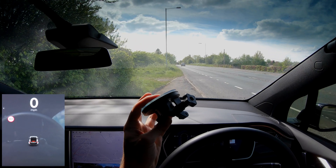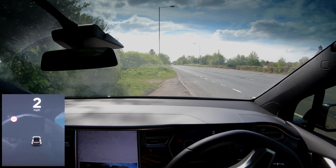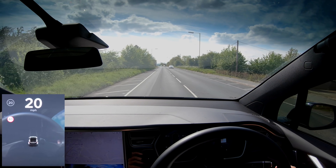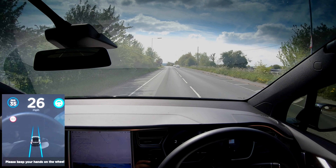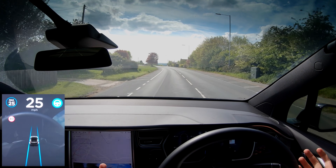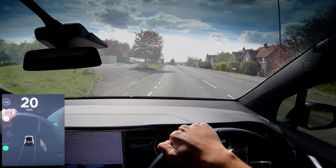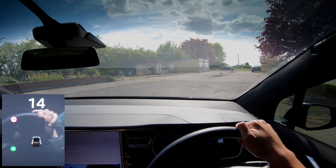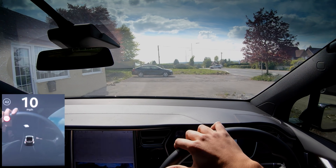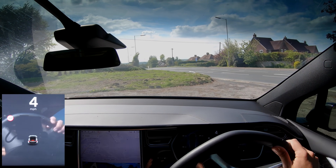I'm removing the final mount — every single camera on this car is now completely visible. The warning sign is gone, and autopilot is immediately available and working fine. It's holding the road. From this test, autopilot will not work unless every single camera is completely free — or at least that appears to be the case. Even cruise control won't work unless every camera is clear. But it could be specifically about that left camera in the front array.